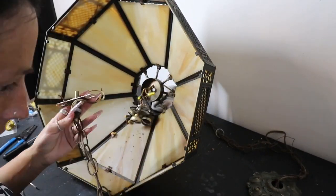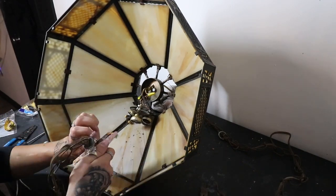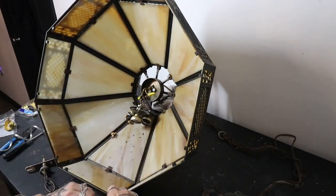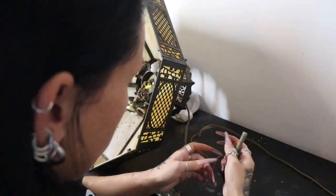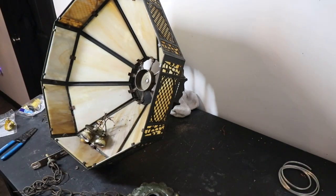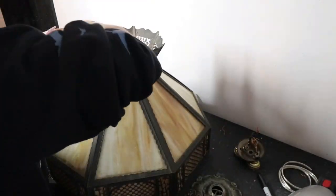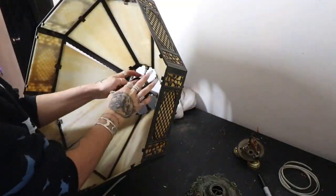I'm going to do my best to explain this as easy as possible. Essentially, what I'm doing is just gutting this entire lamp — removing all of the old light bulb fixtures, all of the old wires, and we're going to replace everything. So first thing I'm doing is pulling out that mainline wire and we're going to replace it with the new 10-foot lamp wire from Home Depot. Lamp wire has two sides, both the same exact thing, but we're going to designate them as different — one's going to be black, one's going to be white.